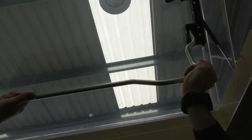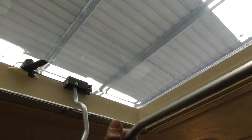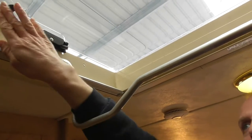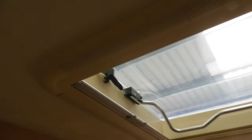Your roof light — on this one you can just pull the bar down. That's the locking catch there. Press the button in and it releases it. Push it up and click the handle back in. Just be careful if it gets a bit windy — could take them off. When closing, just keep it under control as it will drop down with a bit of a bang. You can also put it in a different vent position — there are a couple of locking catches there. If it's raining it's still got a bit of a vent, or you've got a night-time vent — just push it up slightly to open it just that little bit to breathe at night. Just make sure it is clipped shut for travelling.